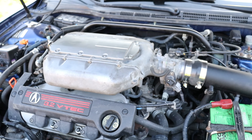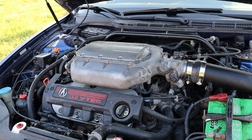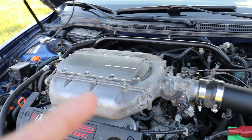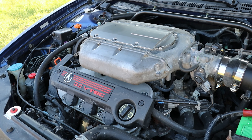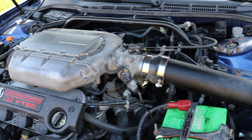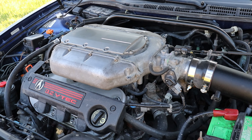There's the mount right there. Apparently the rear mount that Innovative sent me did not work. These are the only mounts I could find for this car and they are made by Innovative. I went with the lowest black mounts which are rated for around 300 to 400 horsepower. I don't plan on boosting this car, so 300 to 400 horsepower doesn't sound that bad.